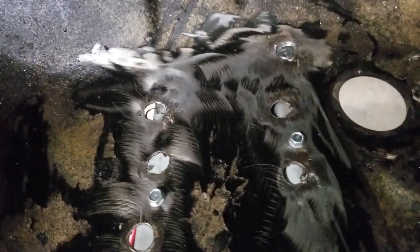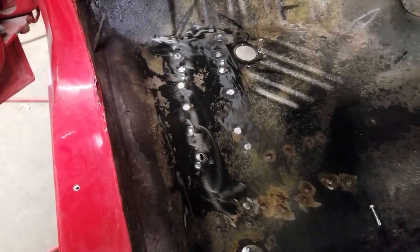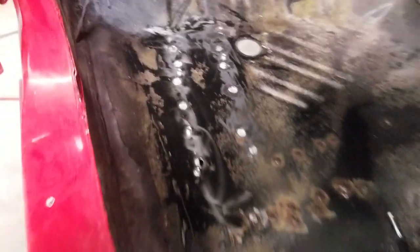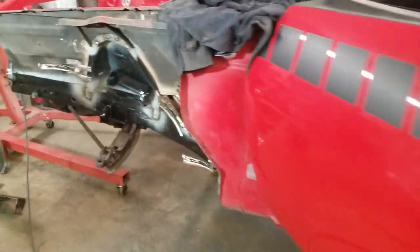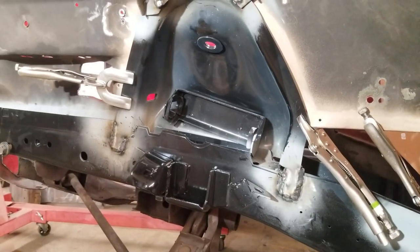Make sure as you're welding that nothing is moving. Right now you can see I have all these screws in place. I had to drill big holes in here too to get the plug welds out because somebody had put new floor pans in this car and had already plug-welded everything. Right now everything is screwed into place with self-tappers — you can see they've got a drill bit tip, and I like to get the ones with the 5/16th head because they're a lot easier to drive through sheet metal without stripping. They make them in Phillips head but those strip out a lot. I got all this in place and you can see the weld-through primer coming through these holes, so I'll replug-weld all these holes. I welded all the heavy stuff first — the shock tower — once it was lined up exactly where it needed to be, and now I'm going to work my way around doing all my sheet metal.